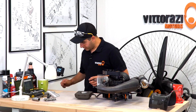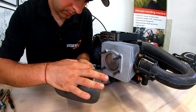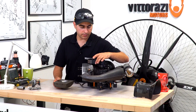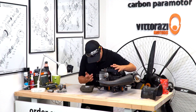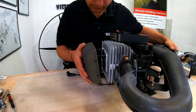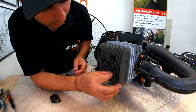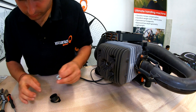We will trash the old o-ring and install a brand new one. Make sure that it's seated in its channel. Everything looks pretty good. Pay a little bit of attention to the gasket in between the cylinder and cylinder block, because when we remove the head, the cylinder may become a little bit loose and this gasket is prone to breaking. Our gasket now looks pretty good, so we can leave everything as it was. Now take the cylinder head — please be very careful when you install it so the o-ring doesn't fall out before it touches the head. Now using a little bit of oil, grease the surface of the washers.